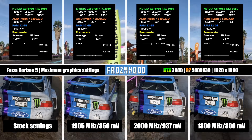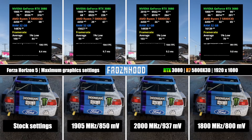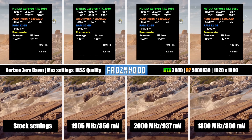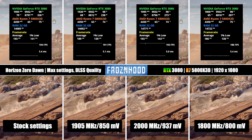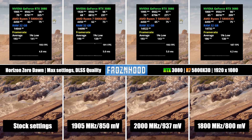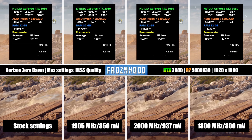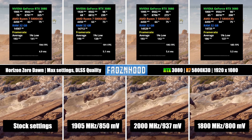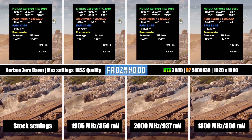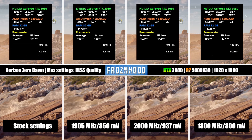I am also showing the profile that is perfect for very hot environments or compact systems. Yes, the performance slightly drops, but what you get is a power consumption below that of the RTX 5070. In Horizon Zero Dawn, with stock settings, the power draw goes above 320 watts and the temperature is around 79 degrees, with 193 average FPS. Keeping similar clock speed but with undervolting again leads to significant power draw and temperature decreases. The more aggressive undervolting settings lead to almost 15 degrees lower temperature and more than 100 watts reduction in power consumption.